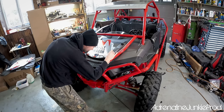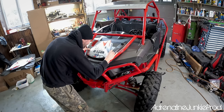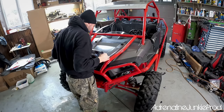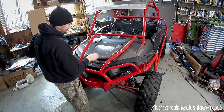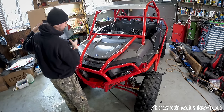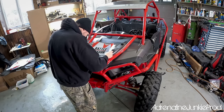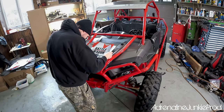Try to find the best spot to start laying it down. Pay special attention to all the contour lines on the hood — the lower spots, the higher spots. When you push something into a lower spot, it'll pull vinyl with it and can affect your fit. You'll have to factor all that in with your placement and factor in the fact that when you push into a groove, the edges will pull in. It might throw your alignment off — you might have to peel it again and reposition it just a quarter inch. Keep in mind, make sure you have really clean hands when you do all of this. Do not contaminate the adhesive. Make sure there's no dust or debris. Once something touches that adhesive like a foreign object, it's game over — you're not getting it off.